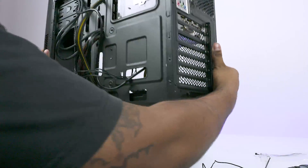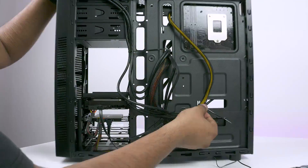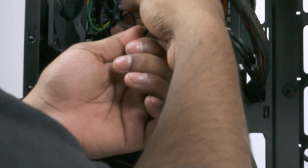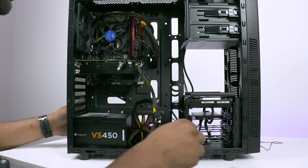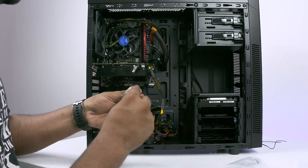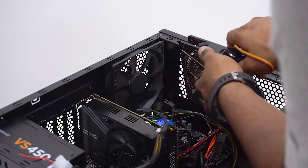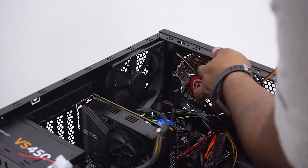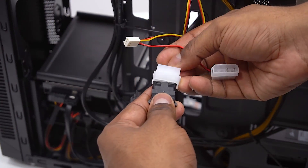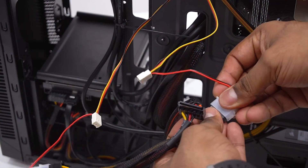We're almost done. Let's turn the case again and zip-tie all the cables for some decent cable management — make sure you pull them all back just about enough. Let's slide the side panel back on. Almost forgot the fan connector — plug it into the header right below the CPU cooler and above the GPU. It's a 4-pin header while the cable only has 3 pins; it will still work fine. I also had an LED strip lying around so I added it for fun — it's not required. I later added a couple of extra intake fans since I hate cases with negative pressure, as air tends to be drawn in from every vent leading to a lot of dust build-up. Just screw them in up top as intake fans and connect them to a Molex connector from the PSU. Tidy everything up, pop the panels back on, and we are done.